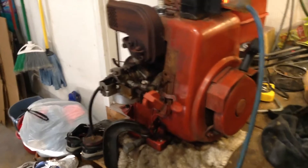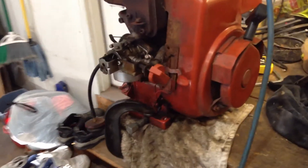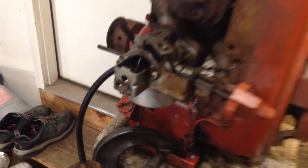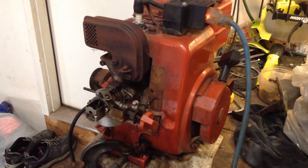So I'm gonna put this on there and have another good running tiller. All right guys, just a quick update — garage is still empty, no tractors. Just needed a few things: new plug, change the oil, clean the carb, and that's pretty much it. This was off a snowblower so I had to take the shroud off, and I gotta come up with some kind of air cleaner for this so it doesn't suck in dirt and crap. All right guys, we'll get another update when I get this tiller together — talk to you later.